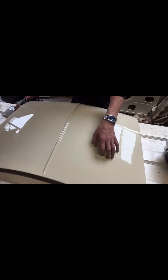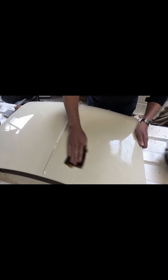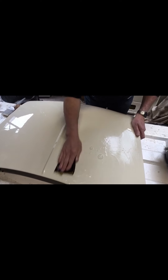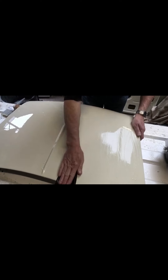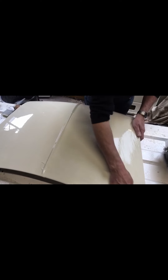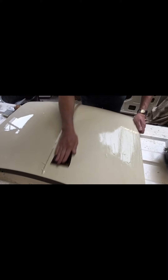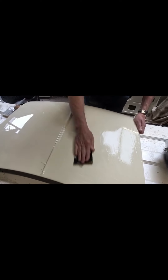These days the mixture is more synthetic, which is very close but made more safe for people to use. Anyway, so what I'm going to do now is rub it down. I've learned my lesson yesterday — I moved the camera so it won't shake. Just rub it up and down nice and gently. Some of you guys out there might think I should use a block, but I've been taught the old way, donkeys years ago. This is how they used to teach me when I was spraying cars 40-odd years ago — you can feel the paint. Never used electric tools where I used to work, never believed in it. All by hand. It was hard work but you soon learn how to get proper results. I've not done it for about 35 years maybe, so I'm new to it the same as you guys.